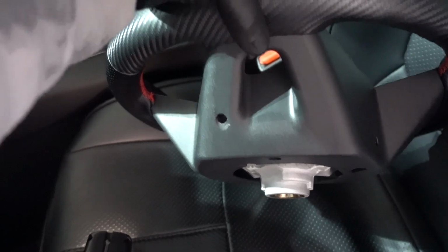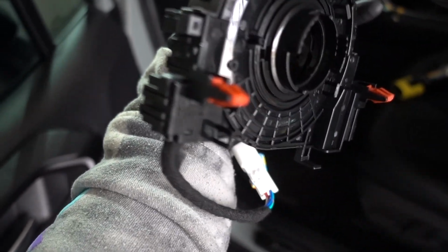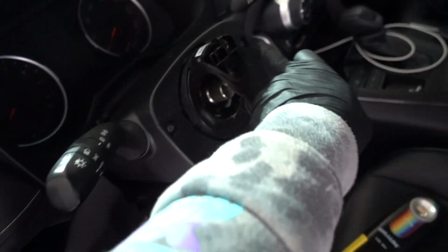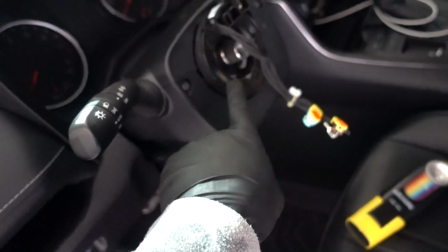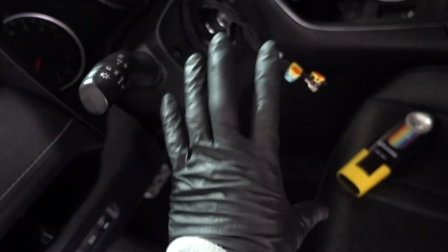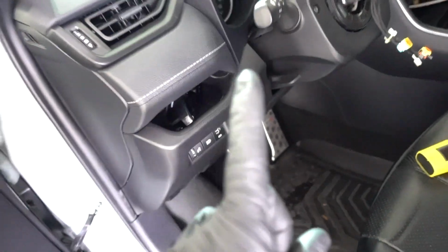Okay, for the new spring plug, it looks like it's being held by those clips, those red ones, meaning that we have to remove this cover. It has those 2 screws and you just have to split it apart and pull on the spring plug, and then we just transfer the new one, put it on, close it. We're not gonna close it yet because I had to run the wires for the new connector, and we need to tap on one of the fuses down there.